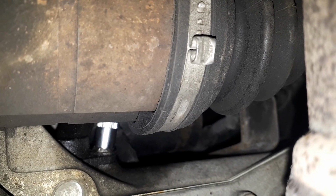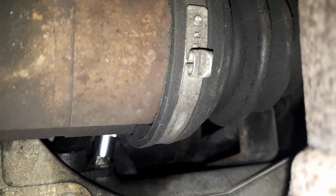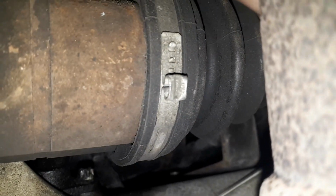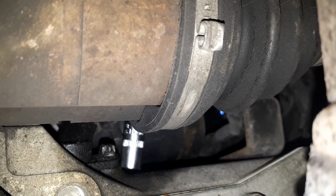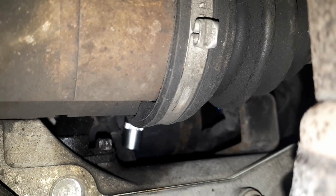It's a bit fiddly to get your hand in, especially while I'm filming, but if you've got a ratchet, I'm using my bar, which wasn't the best idea, you'd be able to do it a lot quicker and easier with two hands as well. And once you've done that, look to where the bottom of the socket is now, where the plastic meets the metal of the engine. Maybe you have to get a flat screwdriver in there to prise it out a bit, but do it gently, because they snap that easy.